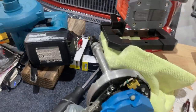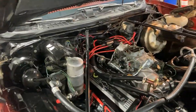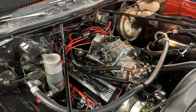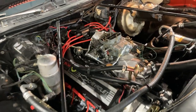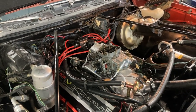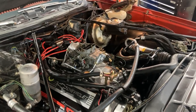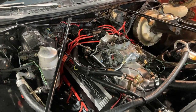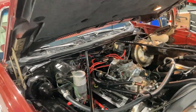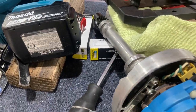I'm probably preaching to the choir for real hot rodders who've been around big blocks and racing, but I'm trying to find a middle ground — street ability and still a hot rod motor. Hot rodders will say just dump the vacuum advance, but that's like putting front runners on your car, taking the sway bars off, and throwing the air conditioning away. It's not a car anymore. We're trying to make this thing work in all forms of life. So if you have a ZZ 502, basically just put tubing on the vacuum advance to reduce it down at least 5 to 8 degrees.